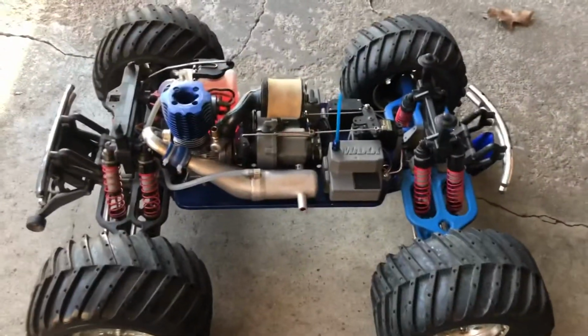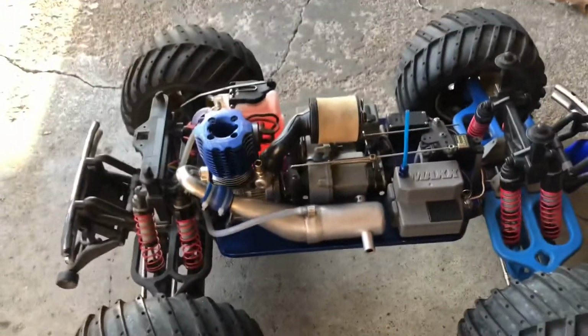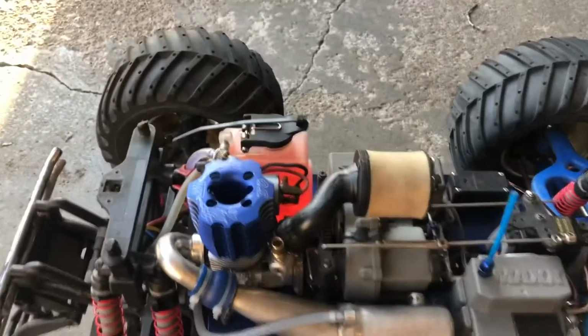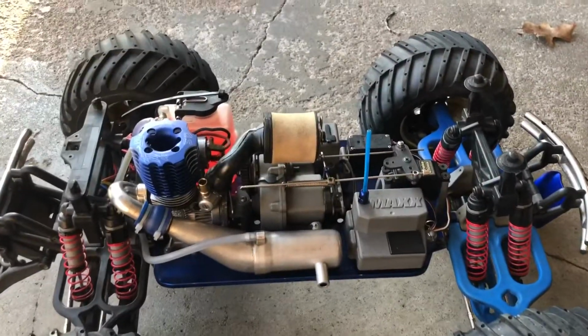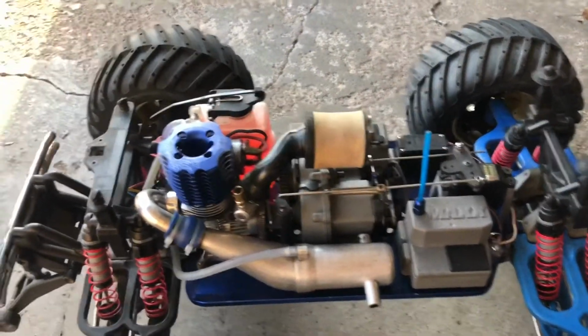All right, guys. Now we're going to be doing the second tank of driving. We're going to be doing half throttle for a couple seconds and then braking. We're going to be preheating the engine before we start it. And this time, run the fuel completely out. Don't kill the engine before it gets low on fuel. It needs to get used to leaner conditions.